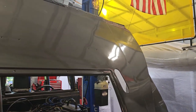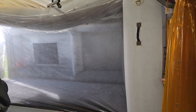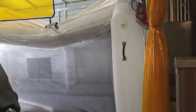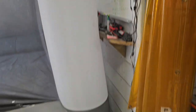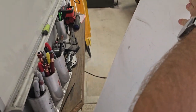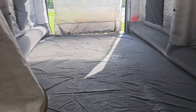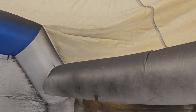Look at the paint we were able to get out of that — it has a little bit of trash in the paint, but for what it is, we're happy and our customer's happy. It's a give and take for the turnaround time we're producing with this on-demand paint booth. You can see how well it fits. If we have painted parts in there we don't push through the side, but when we're prepping and sanding we do. Before we paint every time, we get an air blower and blow out all the cracks — we rarely have problems from the booth itself.